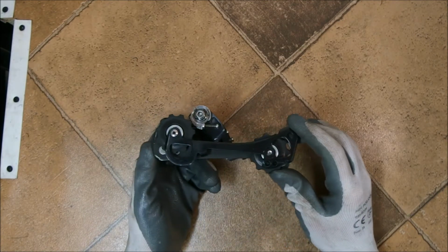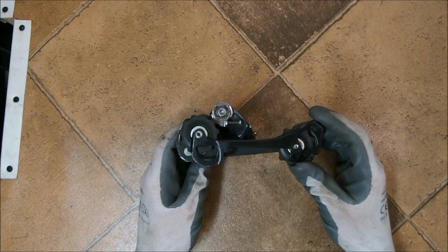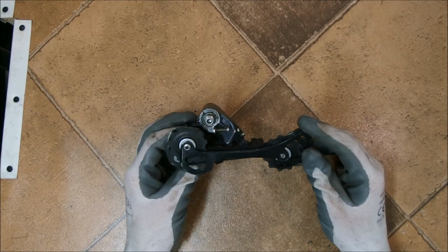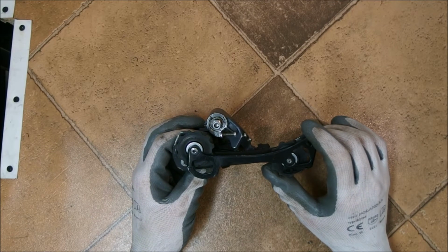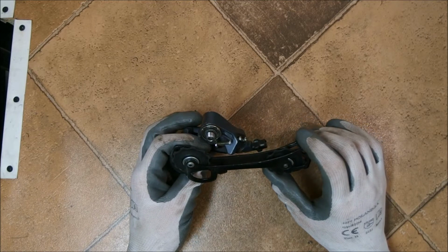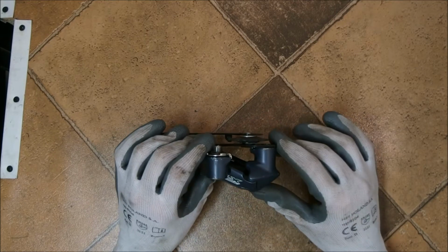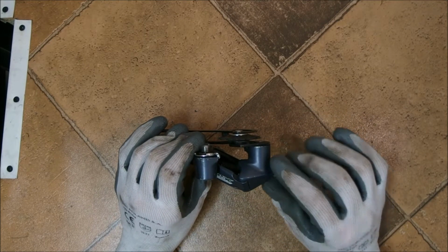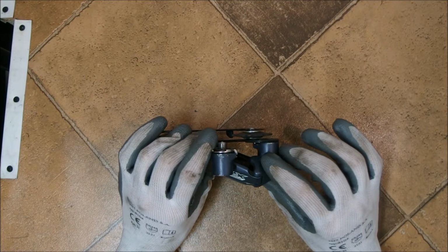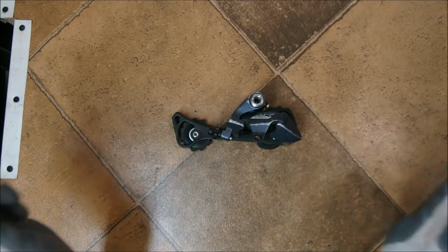There are, however, 2 very important disadvantages to those derailleurs. One, which is very important for mountain bikers, because they are very flexible, they don't hold onto the chain as well as the other design, which I'm going to discuss in a minute. And 2, which is also important for mountain bikers, but is actually annoying to everyone, some designs had a tendency to violently bump on the frame with the P knuckle on certain gears, which actually led Shimano to develop a different design of the derailleur.